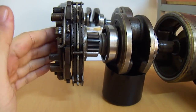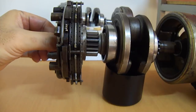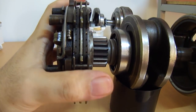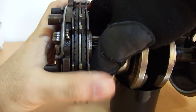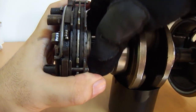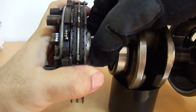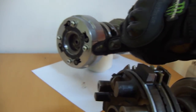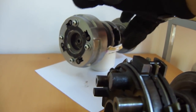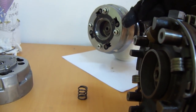How I'm going to explain this may sound a bit winded, but it's all necessary to understand how this whole thing works. Remember how if we grip the clutch sandwich together it would stop spinning — so it's disengaged here, then I apply force and now it is engaged. If you look at the clutch pack from the back, you can see there's a bunch of screws holding it down. Inside it has four of these springs, and that pushes the bell outwards like this.